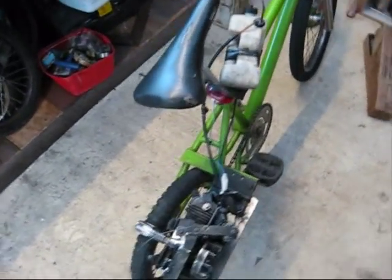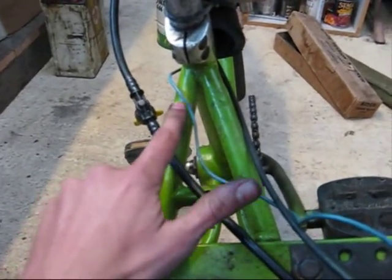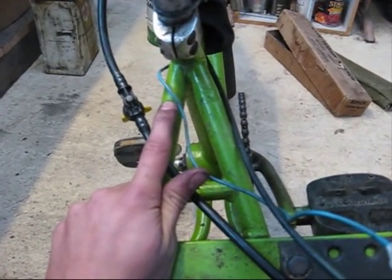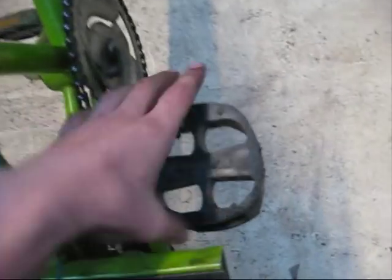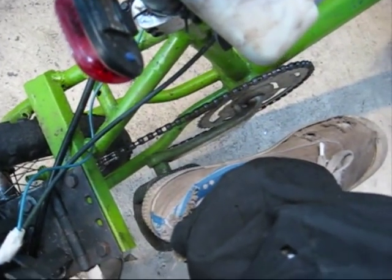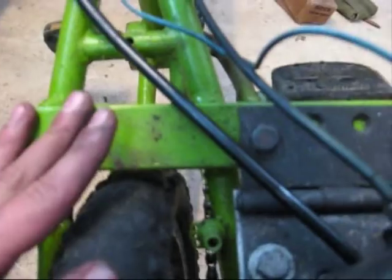First I'll start off with how I mounted the engine. Originally I had this green piece up here because I wanted to use the original 20-inch wheel, but when I pedaled, the pedal actually hit that, and at the moment you can see there's not much clearance. I have to have my foot about there on the pedal, which is a bit awkward at first, but I got used to it. So then I had to just move it down and have a 16-inch wheel.